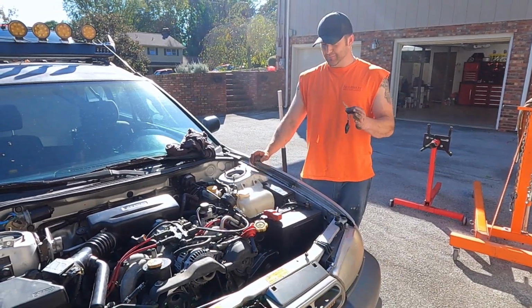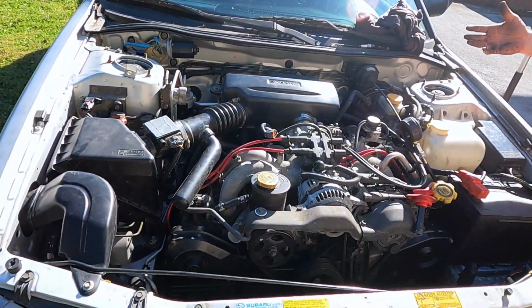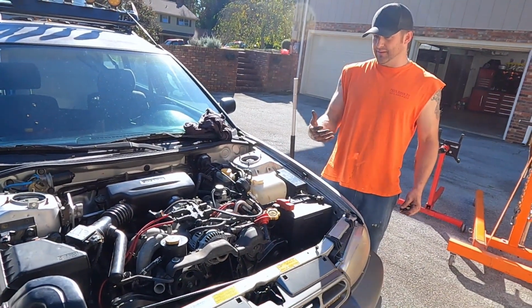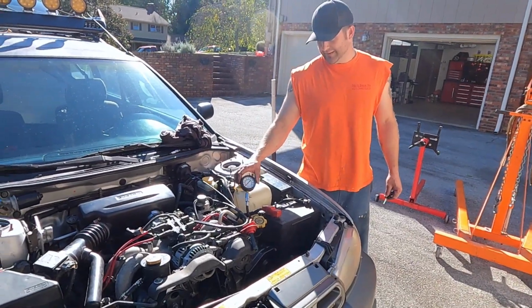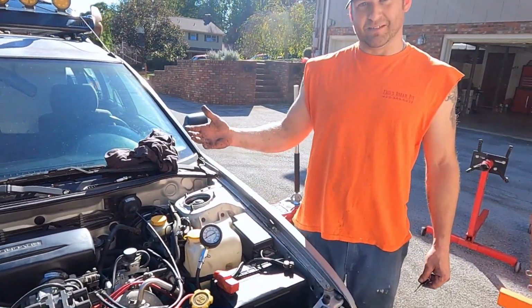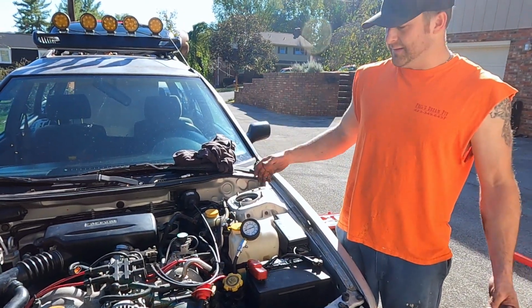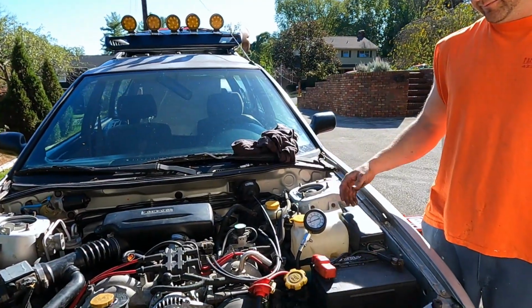All right, guys, look, check it out. Literally, maybe since the last time, 5 to 10 minutes, everything's hooked up. Of course, we don't have the radiator in it or the AC condenser, but we did tell you we're gonna do a compression test. Go back to the previous video and watch the first test that we did. I don't even think it was maybe 85 pounds, maybe. So let's see if our mystery issue was the cam swapped over.